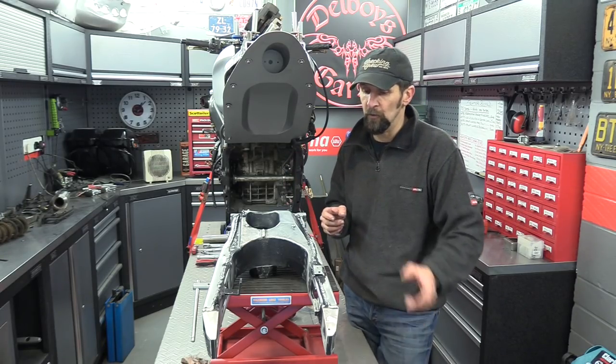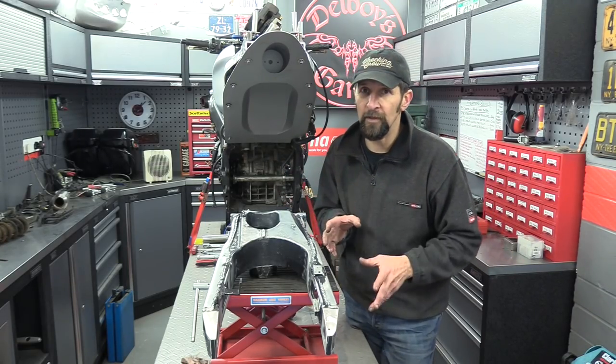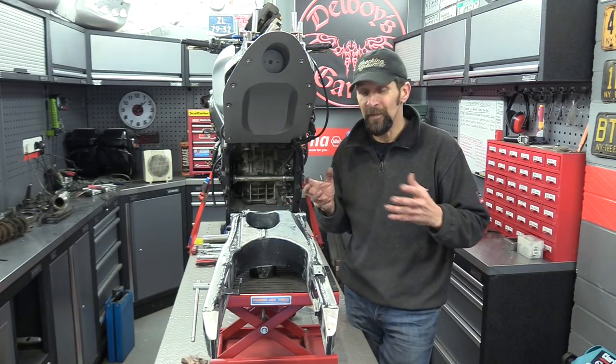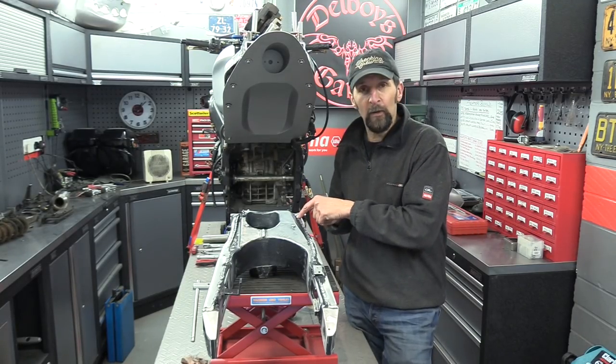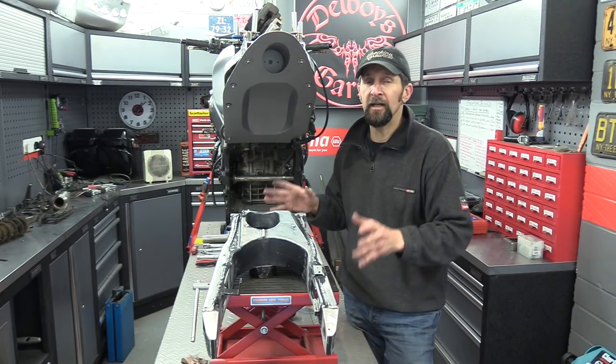Just put a coat of silver or primer or something, anything, doesn't really matter, whatever it is, put a coat of etch primer over it first. Then you put a test paint over the top and let it dry. Now if there's any grease or foreign matter in there whatsoever, it will react with the paint, and then you know, and you can spot deal with it, rub it off, sand it back, degrease, spot prime, resand, and get it good.